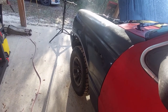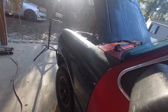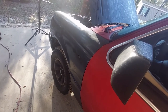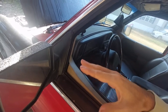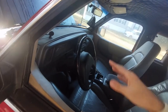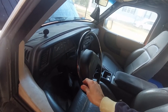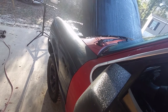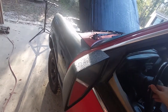When I turn the wheel fairly far, we're getting almost no motion down at the wheel. Once you turn it past the slop, the tires respond appropriately. In the slop, the wheels barely turn, and at interstate speeds that becomes really dangerous. It also affects the turn signal — the multi-switch toggles based on wheel rotation, so with this slop the wheel isn't turning far enough and the turn signal always cuts off early.